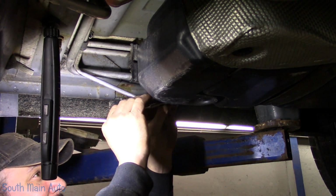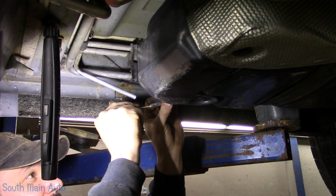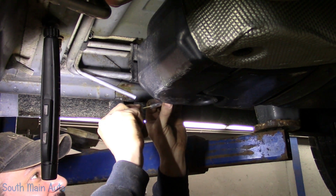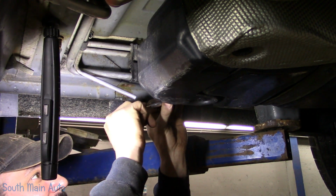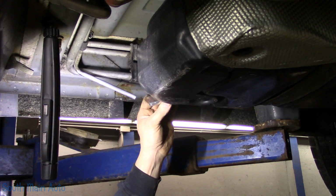So then, I'm going to take a little Q-tip now. No, this isn't just going to shove any of the crap up in the line. The Q-tip's smaller than the orifice. We're going to twirl it around. We're going to have a little look at it. Because this is on the high side now, so just run her around in circles in there. And if there is any debris, it will attach itself to the cotton swab. And take that out. We'll try another swab.